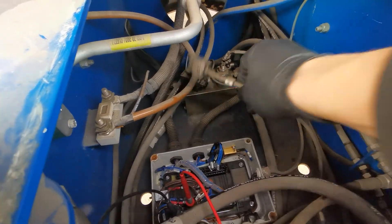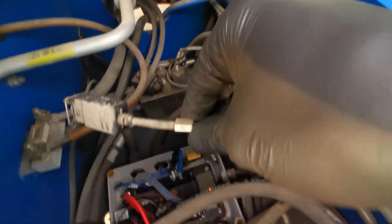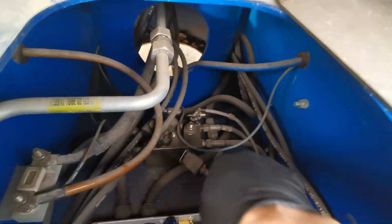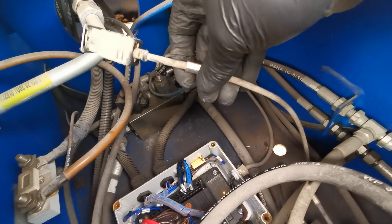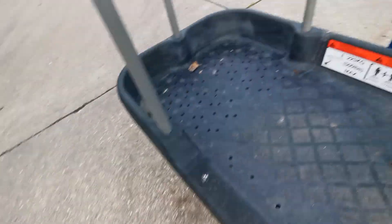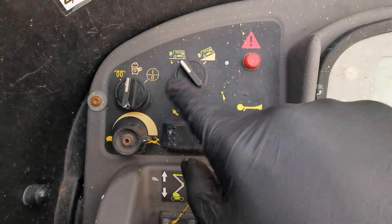One of the differences when driving this machine on electric is this solenoid TRC, which goes on the diff lock. What I will try to do is disconnect the solenoid and drive it that way to see if that's going to improve things, using the same speed selection.